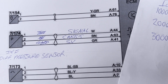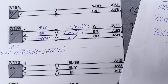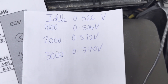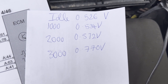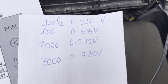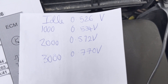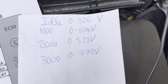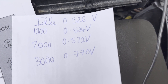I've corrected my drawing with those new signals. With the engine running, I measured the voltages on the signal wire — the white wire — and those are the voltages I get at idle and up to 3000 rpm. I'll take the car for a drive once the battery is fully charged, and we'll come back when the filter full indication has gone and repeat those measurements to see what we get.